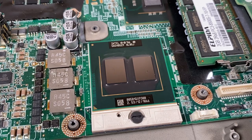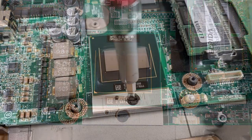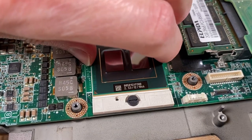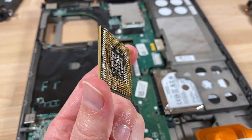Now what's cool about these Core 2 Quad mobile chips is that they don't have a heat spreader like the regular desktop versions, so we can see the two dual-core dies in all their glory. Removing the CPU, we can also see that unlike the desktop chips, this is a PGA CPU — namely MPGA479 — with pins at the underside of the package.